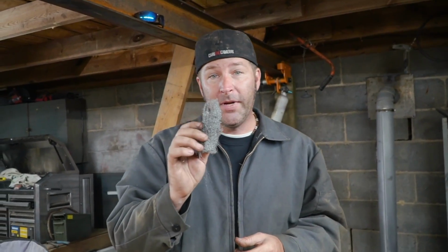Have you ever seen anyone use steel wool on chrome? The medium steel wool, not the coarse. Coarse will scratch your chrome. The medium to fine works great on taking the rust off of your chrome without damaging it. Sweet. Well, more on that in the morning.